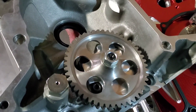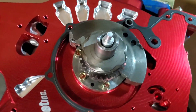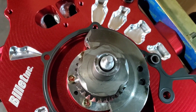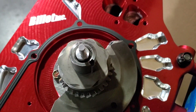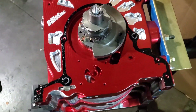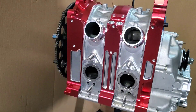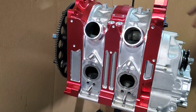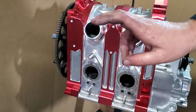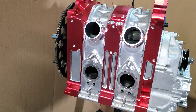We've got our factory dry sump set up and a metal factory gasket for sealing. We'll put a little FIPG silicone on both sides. Now that our front end play is set, our pellet is in with spring, our keyway is in, we can attach our front cover. We've got our gasket down on there with a very thin layer of FIPG on both sides — Mazda factory gasket. Nice billet 13B peripheral port — Wiggins clamps, Chip Ersu, Billet Inc., Mazda Speed front cover, KMR assembled, lightweight rotors, stainless steel inserts. The works. This is a beautiful motor. Sounds beautiful. Turns over beautiful.